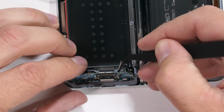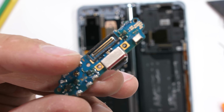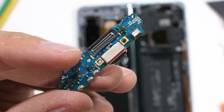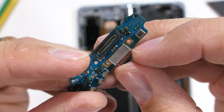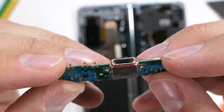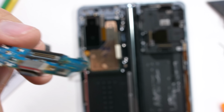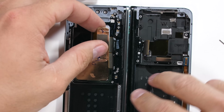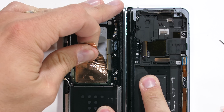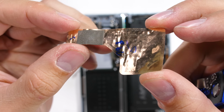Remember how I was going to take this phone apart and see if half of the Fold could still function as a full phone? Well, both sides do have a battery, and one half has an extra screen, so it was a good theory. But the problem is the small screen is on the opposite side of the USB-C charging port, so the Galaxy Fold definitely needs both halves of the phone to still function. Who would have thought? The copper vapor chamber can pry out of the phone easy enough. This little guy just dissipates the heat from the processor, allowing the phone to run a little cooler.